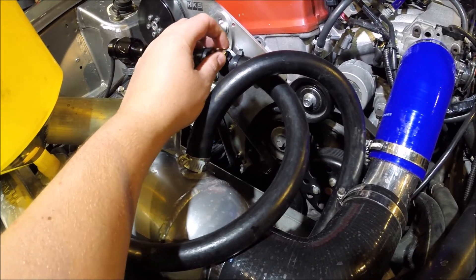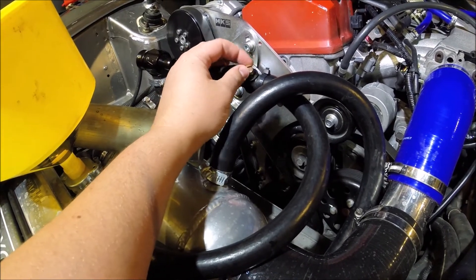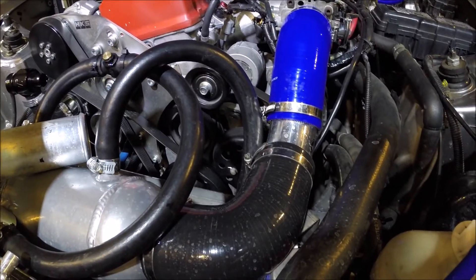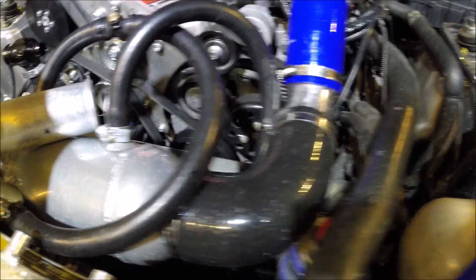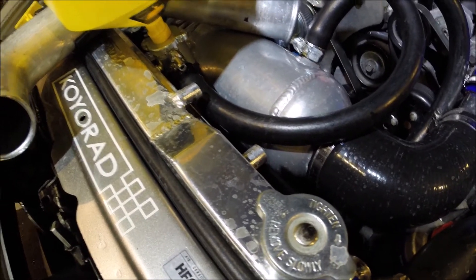At the moment it's not looking like it's going to give me the performance I wanted, which is quite disappointing — but you never get anything perfect first time round. I'll put this bleed screw up here for getting any air out, which does seem to work quite well. I've made sure all the air is out of the tank and the heat exchanger. I don't think it's a coolant issue — I think the charge cooler barrel is simply not able to remove the heat from the air, whereas a larger one will probably do that a lot more efficiently. There are pretty good reviews of those larger-type heat exchangers compared to the barrel ones; the barrel ones seem to be a bit hit and miss.